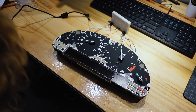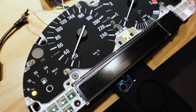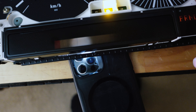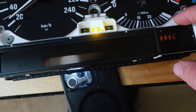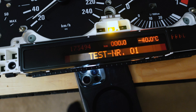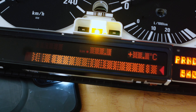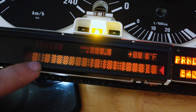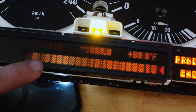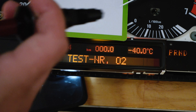The only thing left to do is plug it in. Once all the wires are connected up, turn off the overhead lights so you can see a little better. I have some burned out bulbs on this one so I'm using my phone in the bulb holder. Hold the right button and you'll have your test screen come up. If you press the right button once you go to test 2, then the left button. You can see we do have some sketchy pixels over on the left side — some flickering ones here and some altogether dead ones here — but as far as these screens go this one's pretty good. Now the question is: will this work?